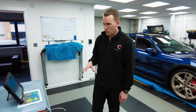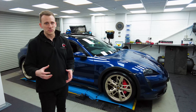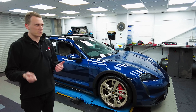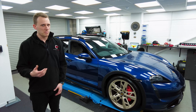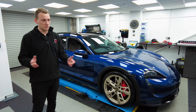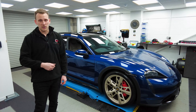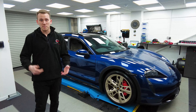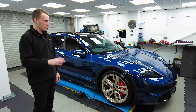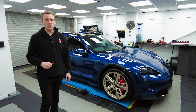Now that's all complete, I hope you guys have enjoyed the video. There are quite a few elements to making sure these cars handle well. Cars are sensitive, and you might think: do a few minutes of toe or camber make a great difference? The answer is yes. If you do have a disparity left to right, it can handle really poorly. With a car like this, with that much camber and caster, they wear and eat into those tyres, so it does need to be tracking in the right direction. A few little tweaks, which we've managed to do today, will have put it right where it needs to be.